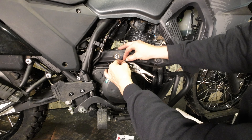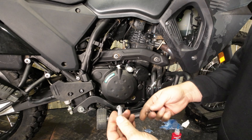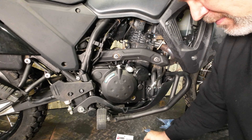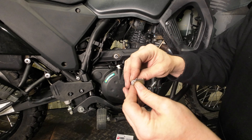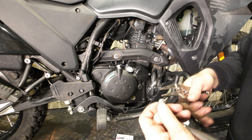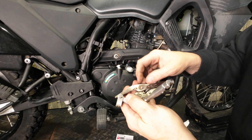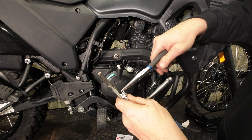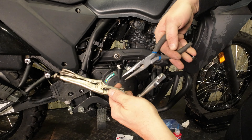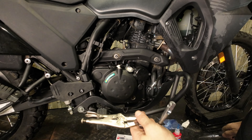This is probably the most annoying part of the job getting this back in here. Take your arm and your clevis, drop the clevis pin through the clevis, and there's a small cotter pin — you're just going to bend this over. If you have needle nose vice grips it's really nice to be able to grab that pin.